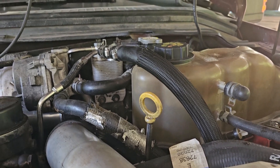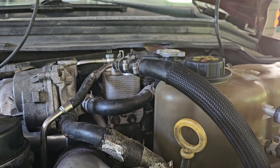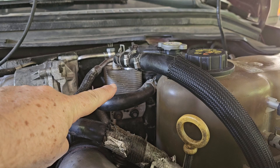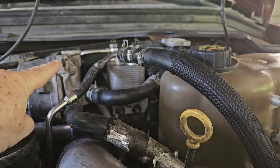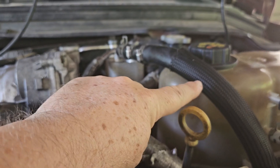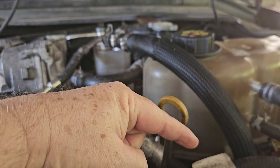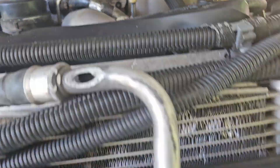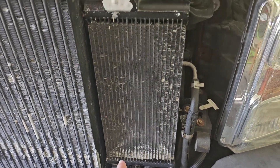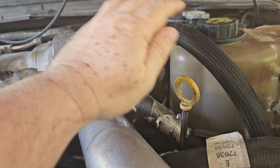You've seen him in a couple videos. If you've got a fuel cooler system on a 6.4 2008, this looks a little different than yours right now because that's part of the repair. What you're seeing here is the fuel cooler — kind of like an exchanger. You've got fuel coming in through there, and the fluid in here is taking heat away. This is coming from a fuel cooler pump that's accessible down in the fender well if you take the wheel liner out, and it pumps over to this exchanger and back through the system.